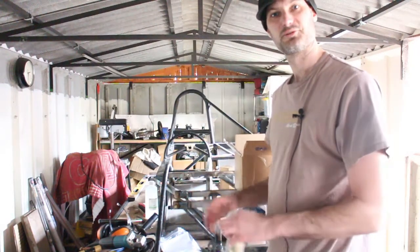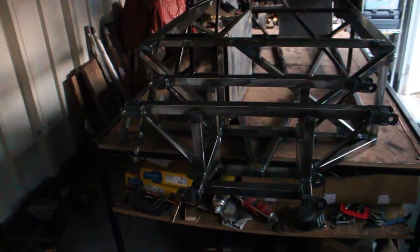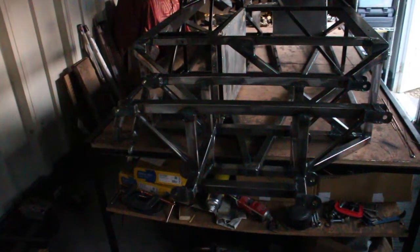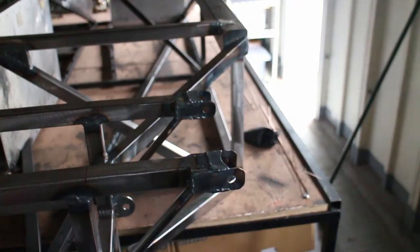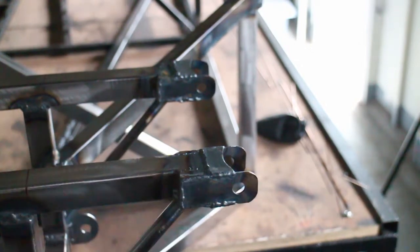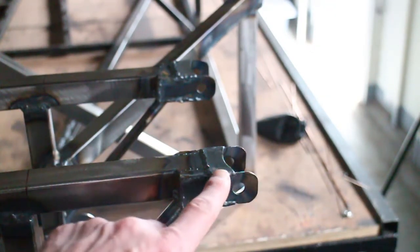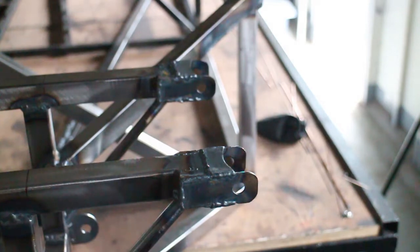Perfect size! I just wanted to take a couple of quick shots — you can see the front end is in. There are the upper ones, the lower ones, and I've even got a wishbone attached. I was actually at Silverstone yesterday and noticed that these ears, although made in 16 gauge steel, had some external support around them on a lot of the cars. I might weld some tube on just on the outside here — I'm not going to do that today though.